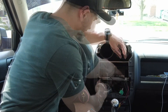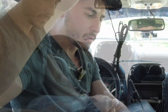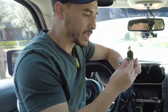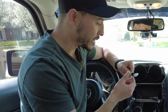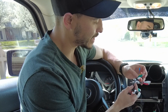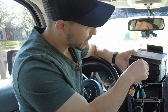We'll throw some wires down in there — this is the climate, we don't need that right now. This is an old microphone from the previous radio; we're going to need the new microphone that came with the Phyllisen. We'll remove the old one and rewire the new one through there once it's installed. All the other cables we're not going to use — those are all your auxiliaries and things like that. The microphone for voice commands plugs into the longest port on the far right — just goes in there like that.